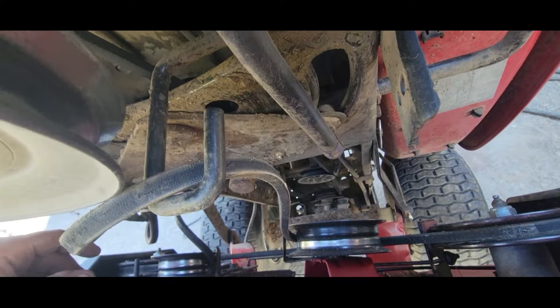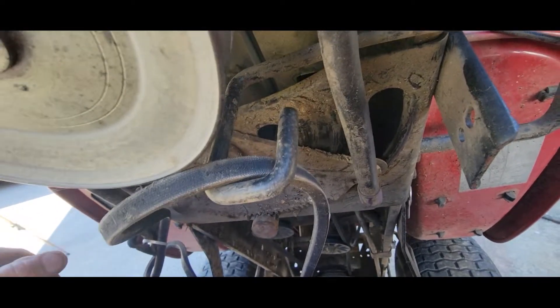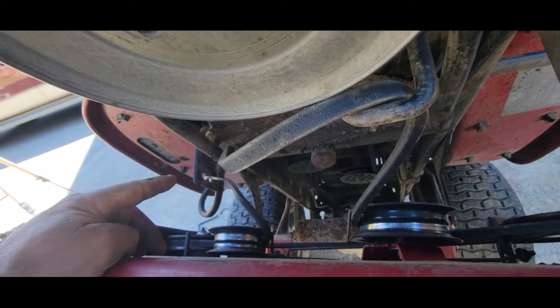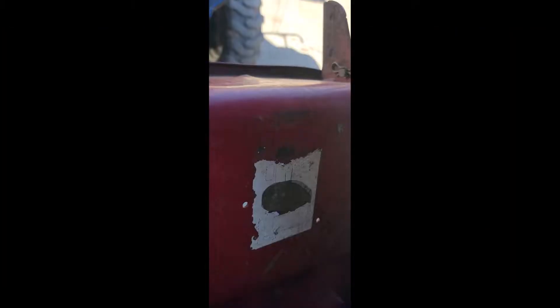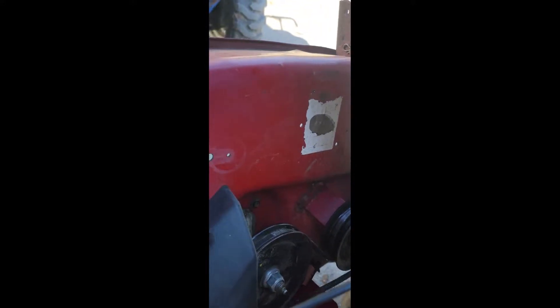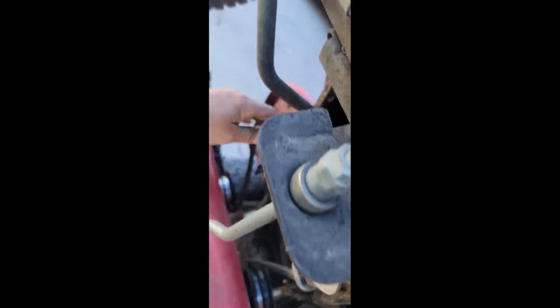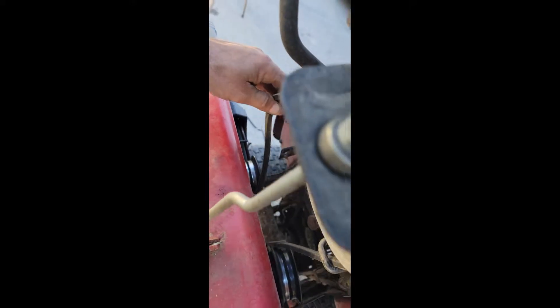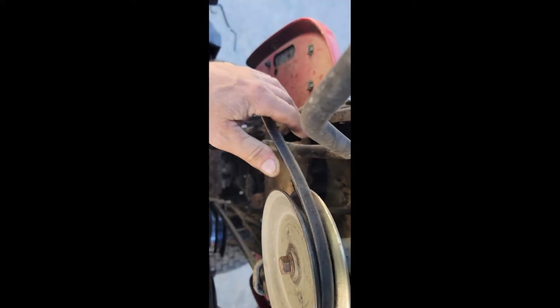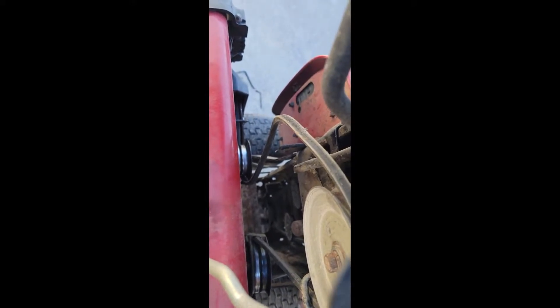I may have to go get an owner's manual or look up an exploded view. Let me cut these zip ties so we can release the belt and put it back on. I used to have a nice sticker showing you how the belt was routed but it's about 10 years old and it's gone. I'll go hunt up the owner's manual. This belt is definitely loose — I bet it goes over on this side to hold it up on the engine pulley. Let me engage the mower — this one's up on the handle.